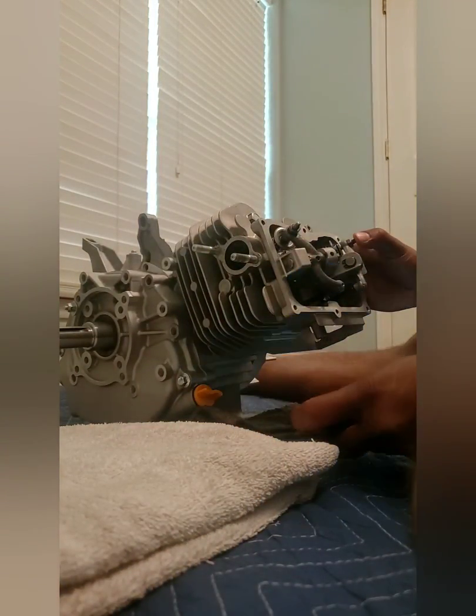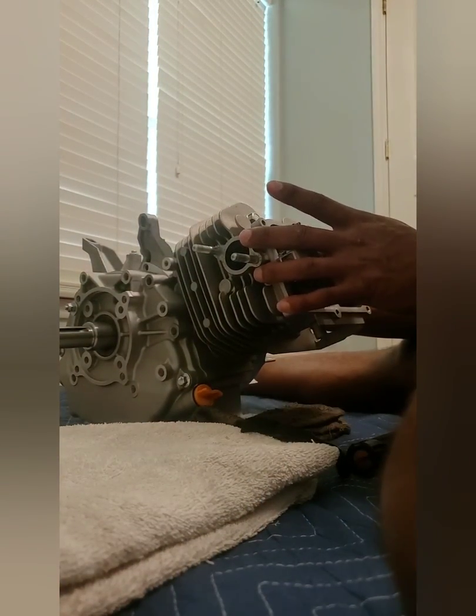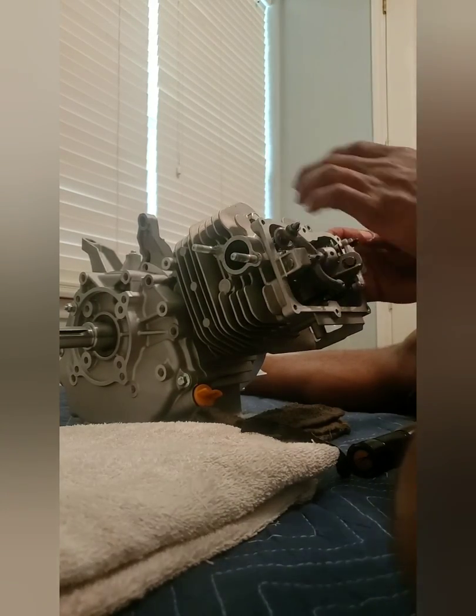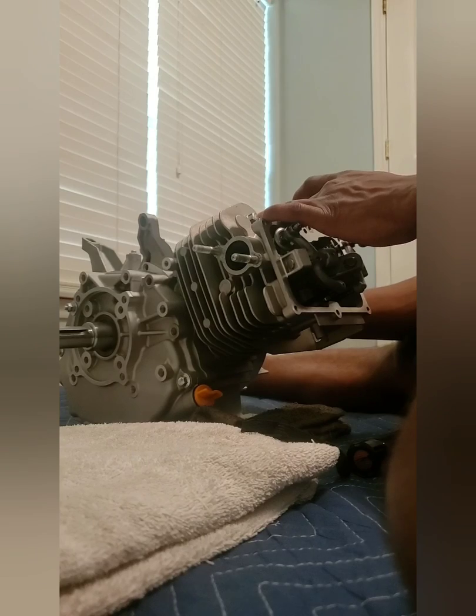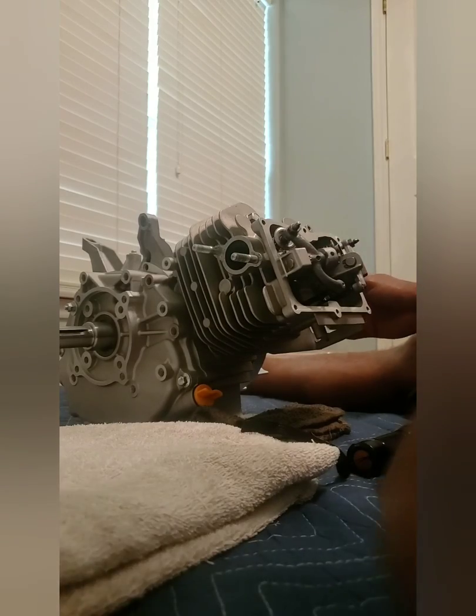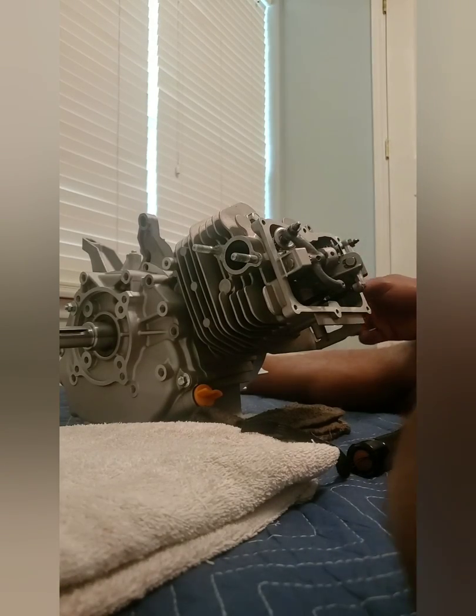Okay. So right, it's my tightest point. Tightest point right here. Okay, that's zero pretty much. Well, right there, that's pretty much zero clearance with the 45 thousandths gap taken up.